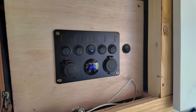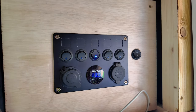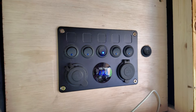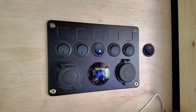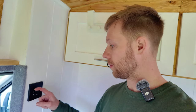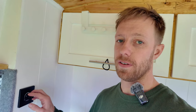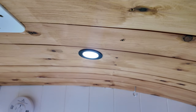Each one of the switches from below runs up to this switchboard. There are two poles of isolation — it's fused here and fused down below as well. These switches correlate to the wiring at the bottom. The spotlights are on a dimmable switch. I've got four in the van, they're 1.5 watts each, and that's plenty for this medium wheelbase Transit.